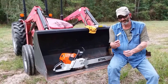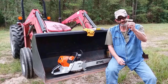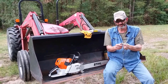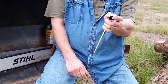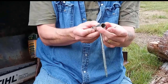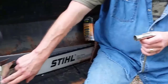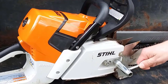You're going to need one tool to start this operation: a scrench — screwdriver on one side, wrench on the other. Stihl uses the large end, the 19-millimeter side right here. If you were using this on a Husqvarna, it uses the small end, the 13-millimeter side. This will correspond to your bar nuts on your chainsaw.